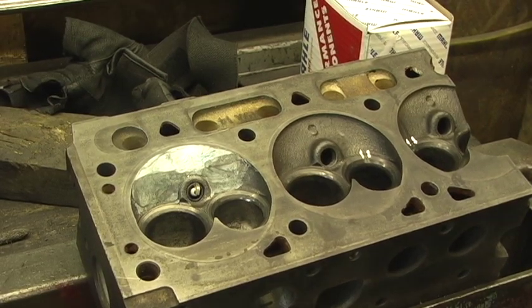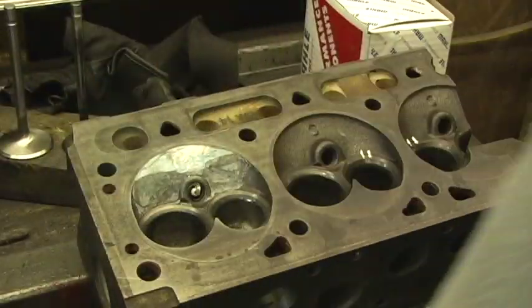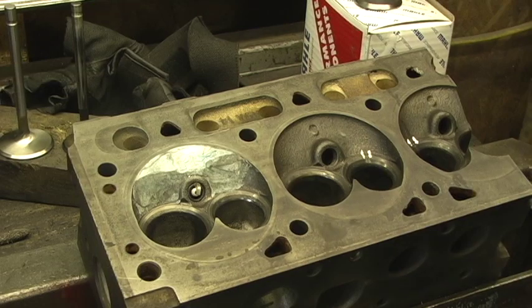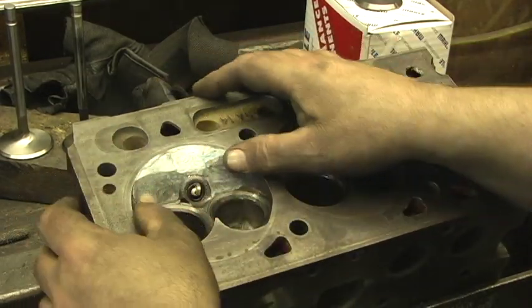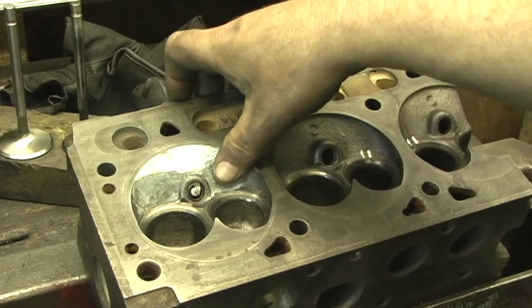What we're doing right now is a pre-clay mock-up. I actually got both of the valves — the ones that are going in the head and the ones that are the stop valves that come out of the head. Anytime you can eliminate dead space, it has nothing to do with compression, although that is part of it. Anytime you eliminate dead space and fill it where it's got a curvature, you just made the combustion chamber more efficient. The clay represents the area that I'm going to weld.